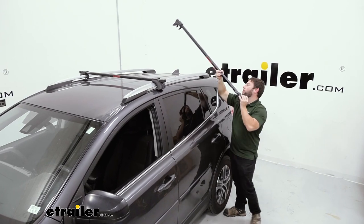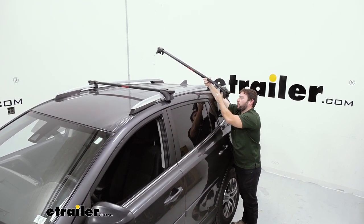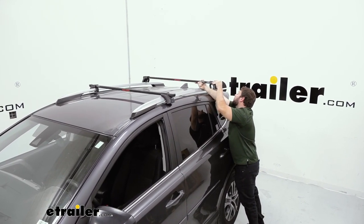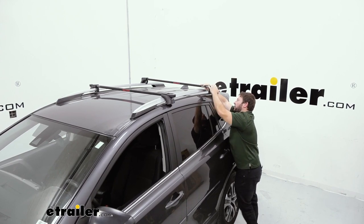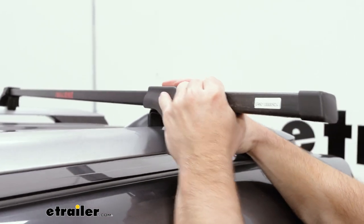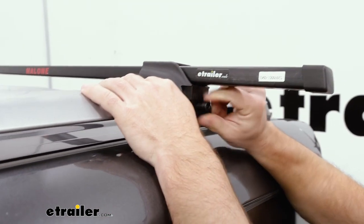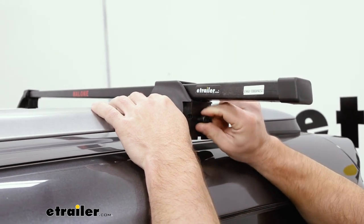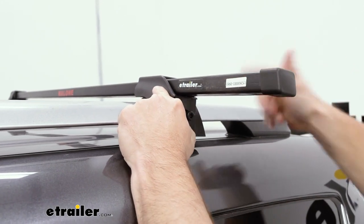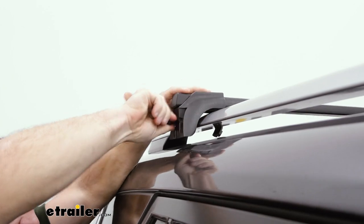When you're going to set it on your roof, you have the rubberized clamps here, so if you make any contact with the roof you don't have to worry about scratching or damaging it. We're going to aim for the bars on both sides. Because these are thicker raised rails, you might have to push down just a little bit to get it to go into place, because you don't want this bolt to completely come out. Now tighten it back up by hand just a little bit, then get the other one in place on the other side.